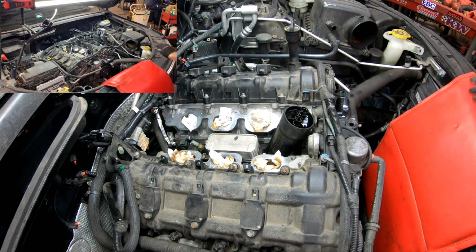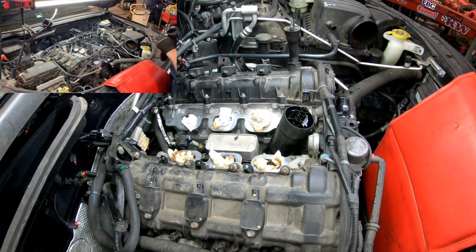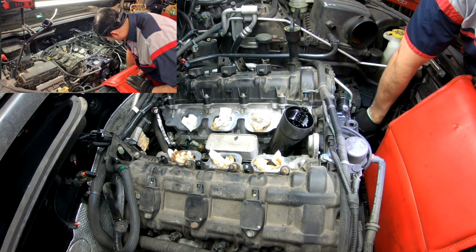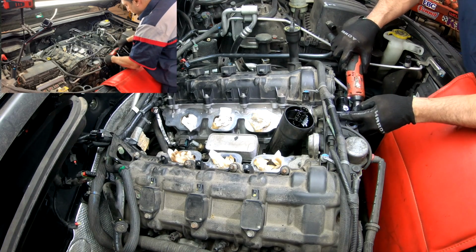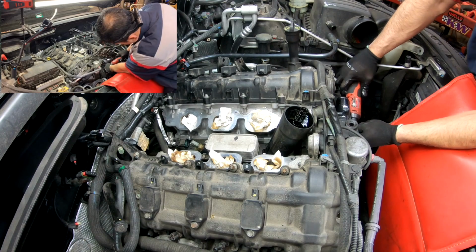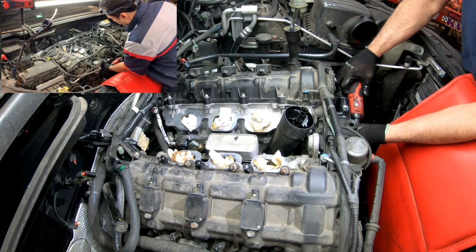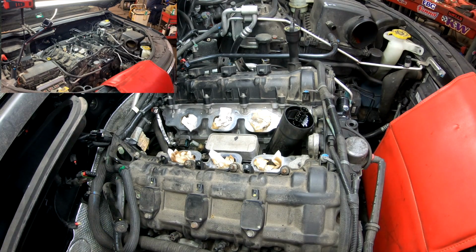And it looks like the thermostat is just held by two tens. I wasn't going to record this repair, but I decided later to do it, so that's why the manifold is out. And any time that you have an overheating issue on a car, I would recommend to replace the thermostat and the coolant sensor.